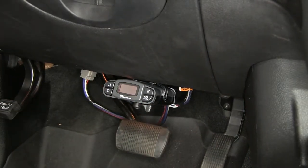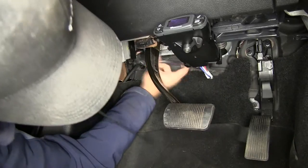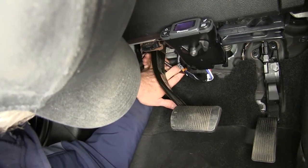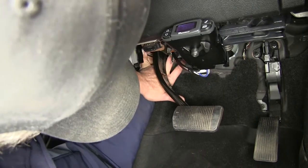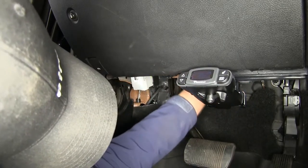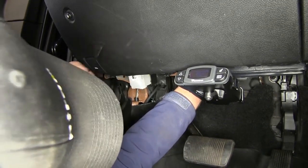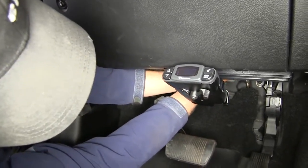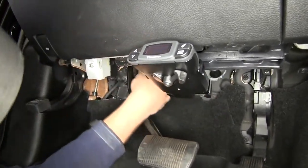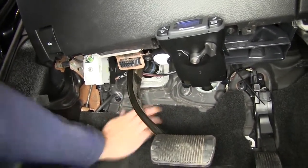Now at this point the controller's installed — let's get that wiring tidied up. Let's get our wires tucked up here where they'll be out of the way. For the excess wiring we've got a nice cavity over here that we're going to be able to tuck most of this up into. We don't want to secure to any moving parts, but we can come to the solid part of the steering shaft up here, put a wire tie right around there, and that should be perfect — it'll have everything up and out of the way. We've got the rest of it tucked away nicely over here in case we'd ever need to get to it. Now let's just trim off the end of that zip tie and that'll have it taken care of.